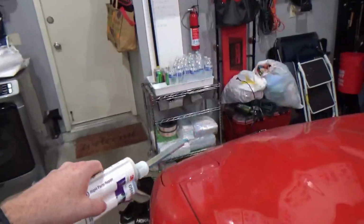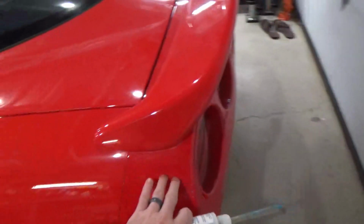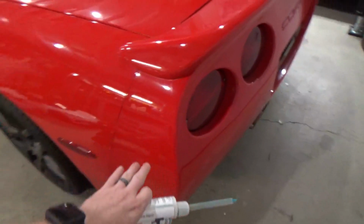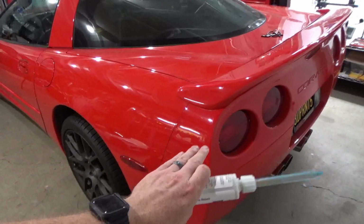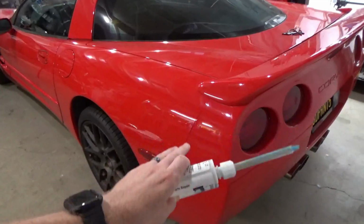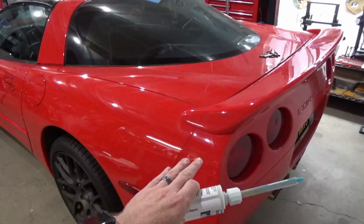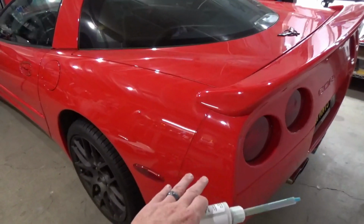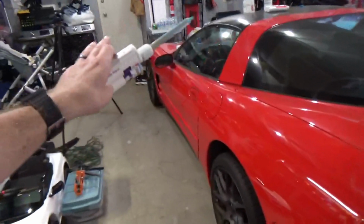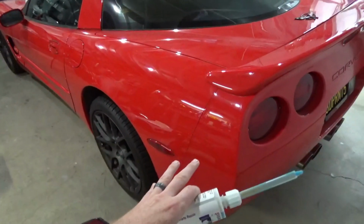So if you're doing the front bumper or the rear bumper, again, these are a polyurethane, they're not an SMC, and it is a polymer, but you can't plastic weld this. And this is what I was saying earlier, this is a thermoset plastic, which means that when it heats up, it just burns. It does not remelt. So you cannot use traditional plastic welding on these rear or front bumpers on this car. Ask me how I know, because I actually tried it and all it does is just burn.